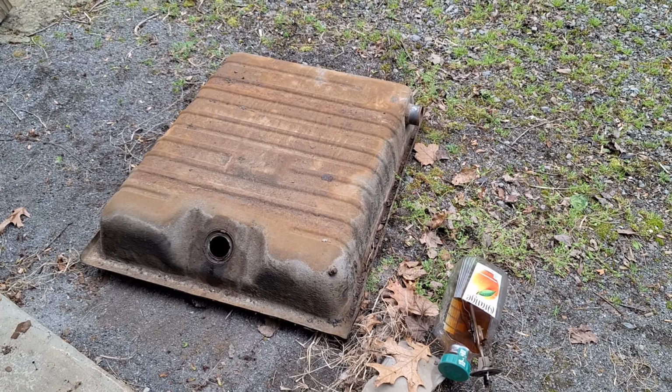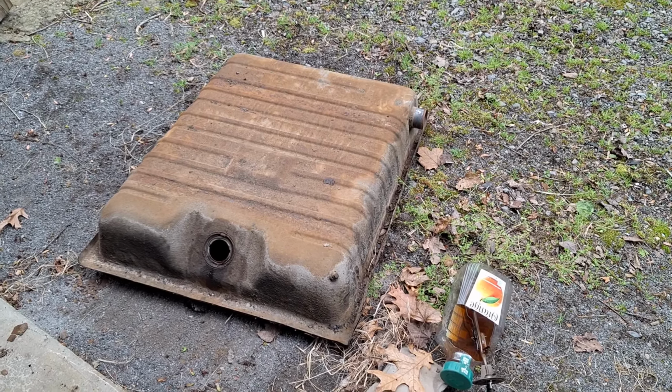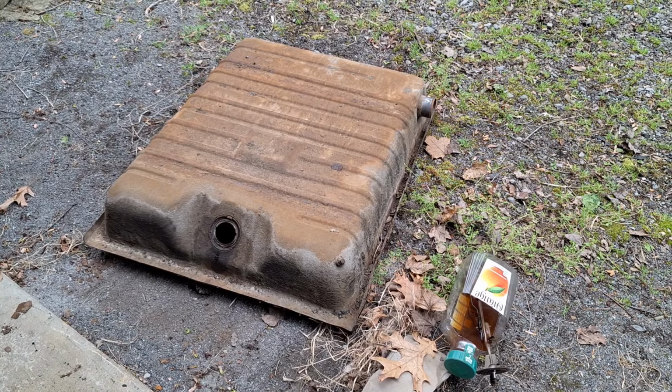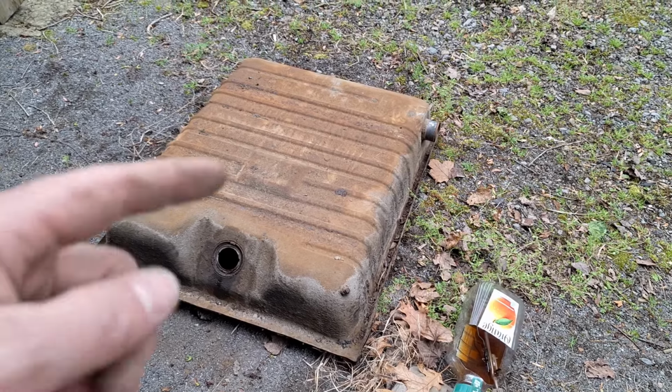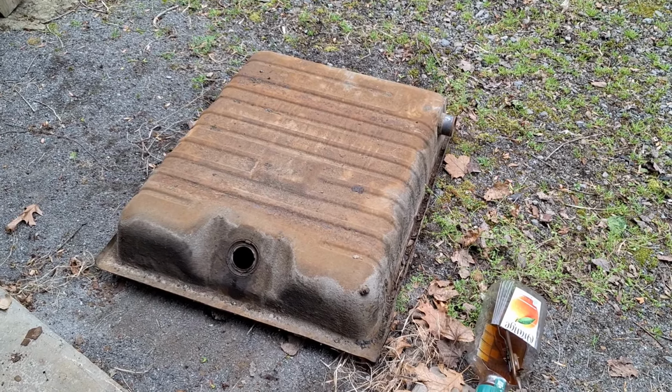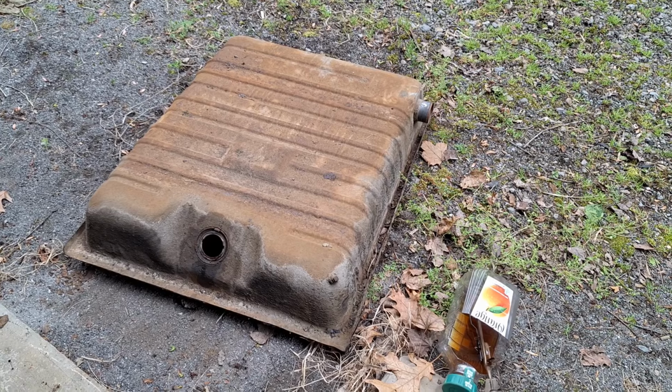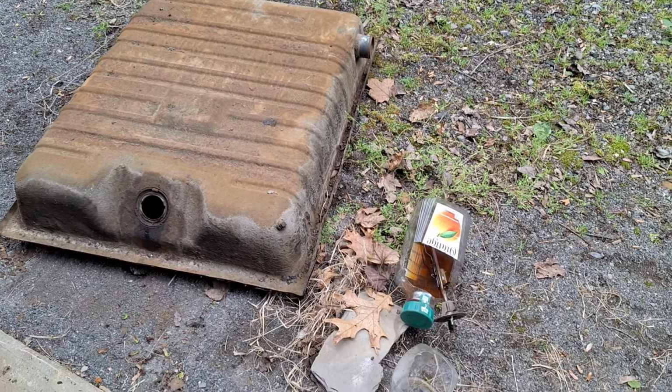So, the follow-up to night 4, looking at the next day, I realized that we and a lot of other places sell the replacement 16-gallon tank, but this one from the wagon is actually a 20. So I'm glad I measured it. You can get the 20s. They are a whole lot more expensive, and the sending units are a lot more expensive.